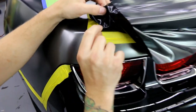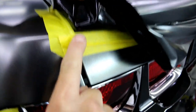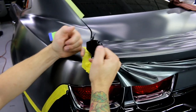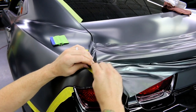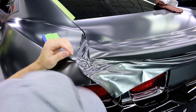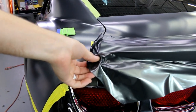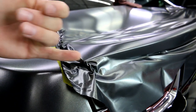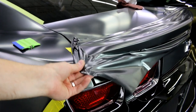Check this corner out — this is a very thick corner, very tall profile. It comes down very far from top to bottom, so we need to actually get the vinyl around this corner for it to turn out nice. That's the difficult part. If you run into a lot of trouble here you can do a cut-and-fold technique — just cut down one piece and fold the two pieces over — but it's just not as nice.